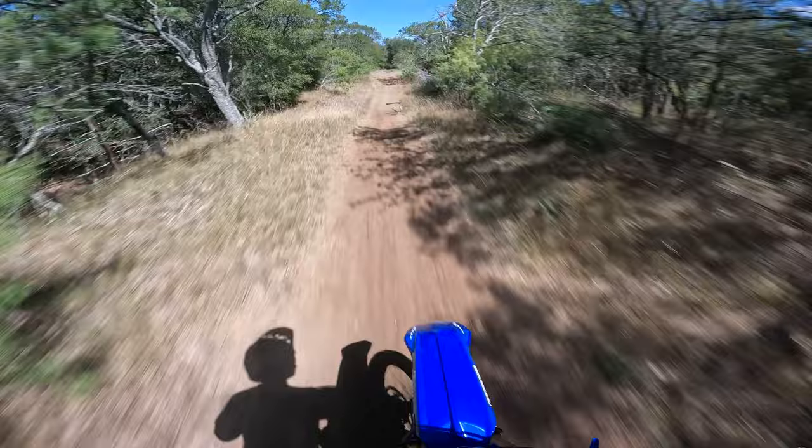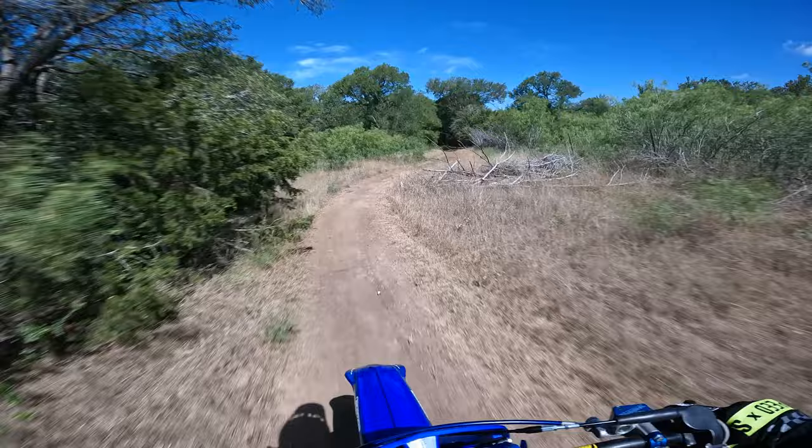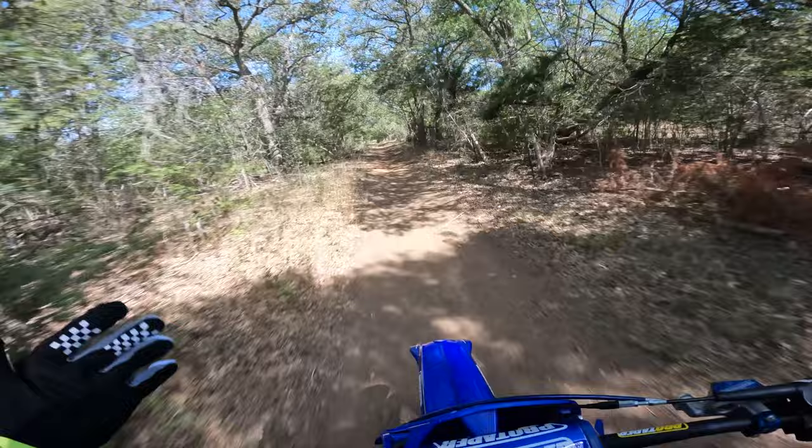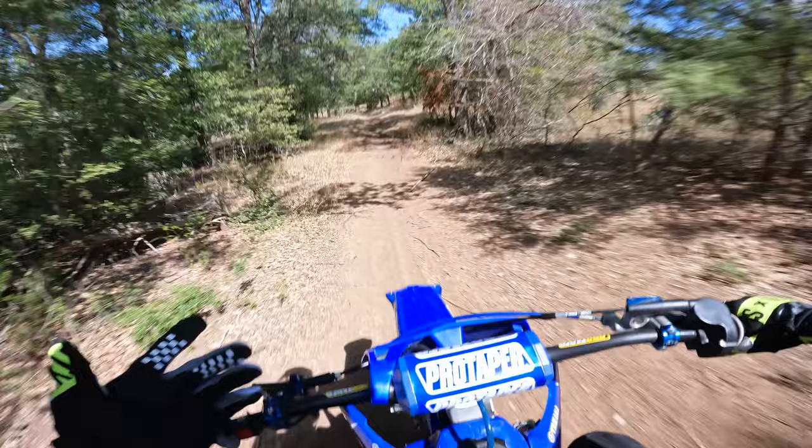So yeah, you guys just heard that. Thing runs dang perfect on the main. But when I get back down to that pilot jet, you can hear, it's not terrible. Two strokes will make that gargling sound at low RPM, but I know for a fact this one's running a little rich.